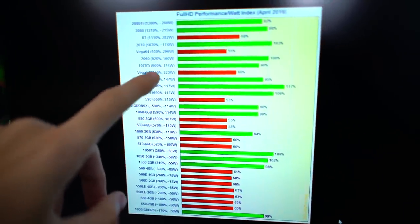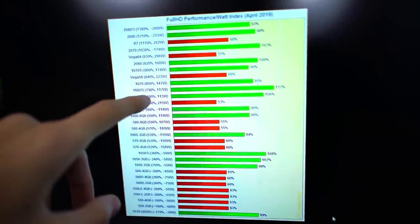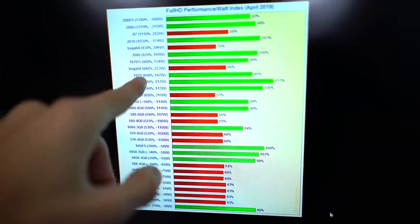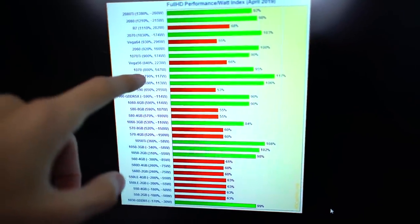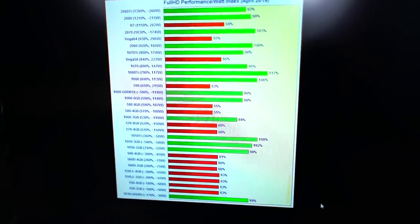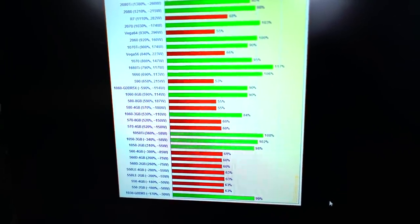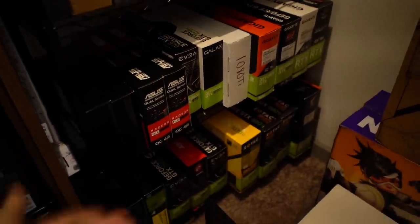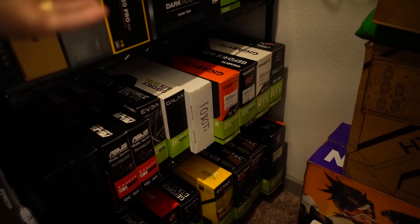We have one from Gigabyte, and I'm gonna strip the fans off of the shroud and see how far we need to downclock it in order to get it stable without a fan. I don't know, I think this is a good place to start. If the 1660 Ti doesn't work, then maybe the 1070, which is a really good card. I wouldn't want to go as far back as Maxwell though, because Maxwell was pretty power hungry, relatively speaking. That was one of the big advantages of Pascal at the time, and one of the reasons why I really liked that architecture. Now, if you will excuse the mess in here, you can see we have a lot of cards to play with, but I'm again pretty sure we're gonna wanna stick with something like a 1660 or a 1660 Ti.